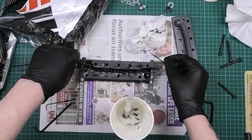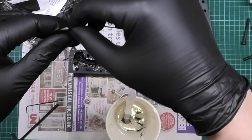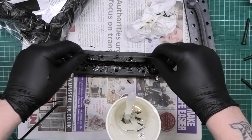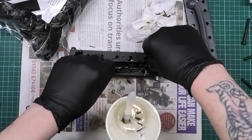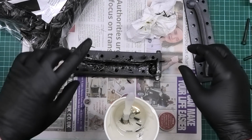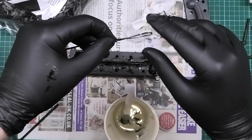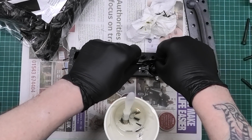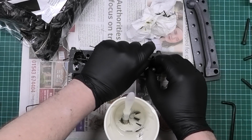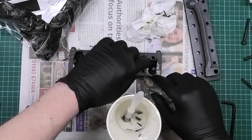so literally I'll fold one of them in half. Now this is supposedly to increase the strength. I mean, theoretically, you know, it should work. Because these chopped strands, obviously, they're not directional, they give strength in every way. But these should give directional strength.